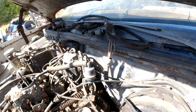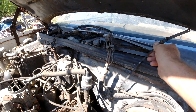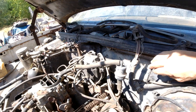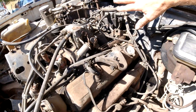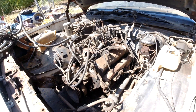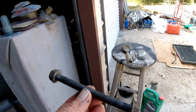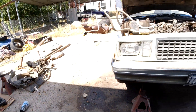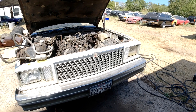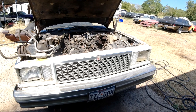She's ready to pull. Got all the wires up there out of the way so nothing gets bound up — just look between the firewall and the engine and see if anything's there. Got the two motor mount bolts out. It's all metric guys — 18 and 16 — two of them, they slide right out. Take them out before you put any pressure on it; once you put pressure on it they're going to be really tight and you'll be sitting there with a hammer and screwdriver trying to punch it through.